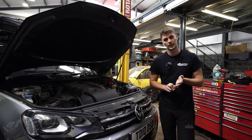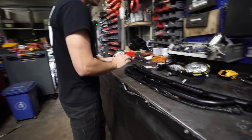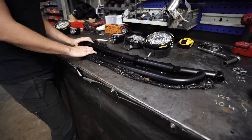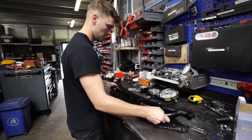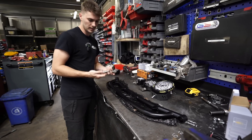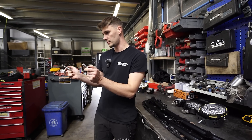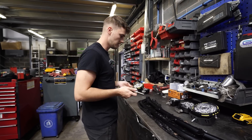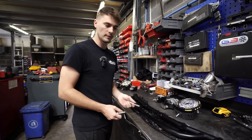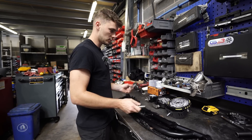Now we're going to be fitting a light bar to this. This is the final bolt-on light bar kit that we've got. It is 100% bolt-on because we've had these stainless left-hand threads custom-made and they screw into the standard tow-eye points. So it literally takes five minutes to fit this. Obviously there's a little bit more involved when you come to wiring your lights, but the bar itself installation — five minutes, job done.